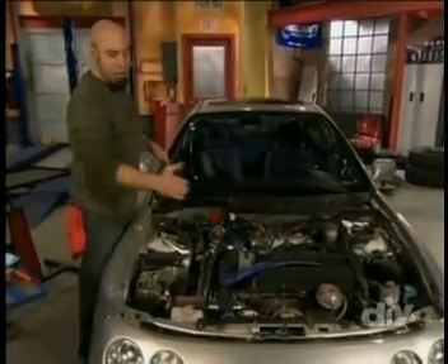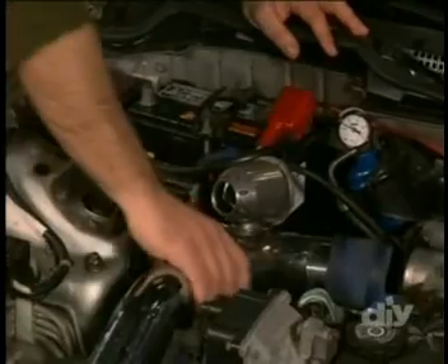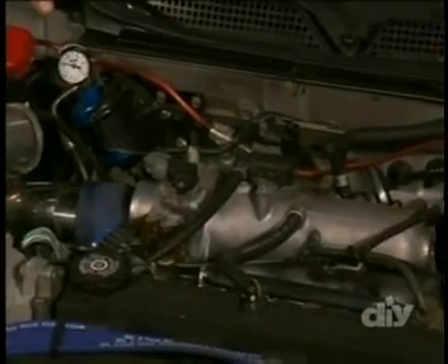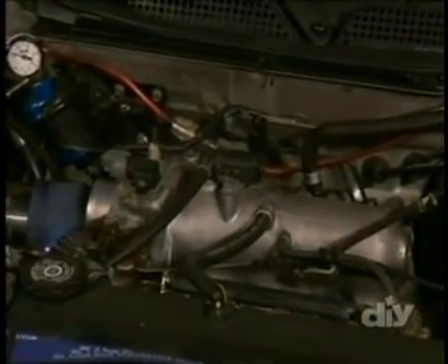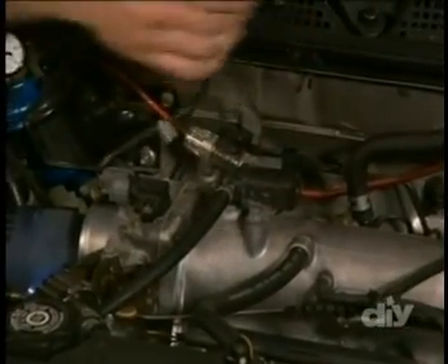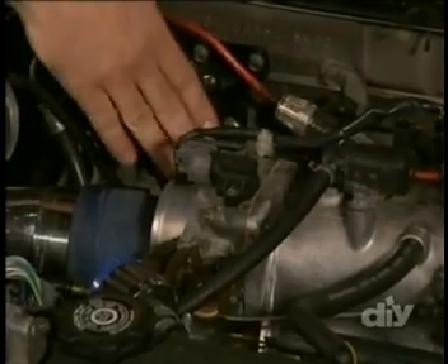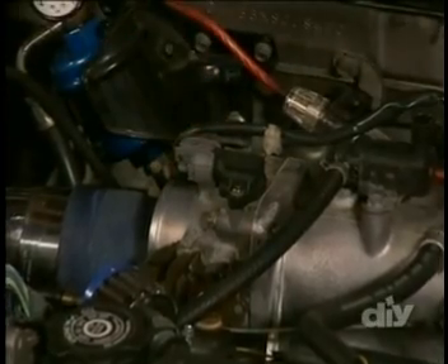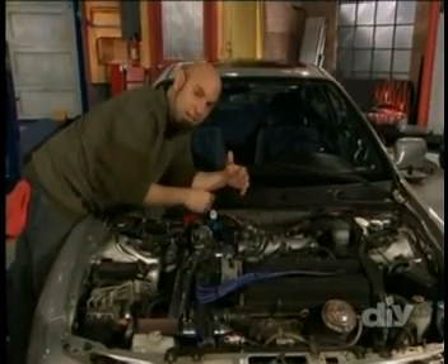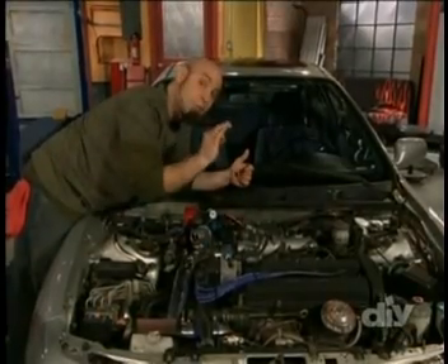To start this project, I've already drained out the radiator coolant, disconnected the negative battery terminal just to be safe, and popped off the intake pipe. When we get into this manifold project, there's a few things you want to look out for — these plugs right here. First, let's pop off this canister purge plug — it just comes right off. The plugs in question are the air temperature sensor plug and the throttle position sensor plug. These two plugs are interchangeable, so you want to mark them so you put them back in the right spot. This TPS, or throttle position sensor plug, already has a yellow streak on it, so we're good to go.